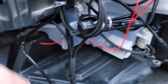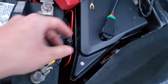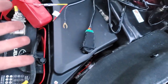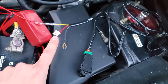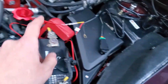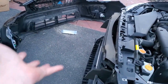With the washer fluid there, there's just not a lot of room. I ran some of the wiring up through here, hooked it up to the battery and the ground. I have my switch here just to test it and see if it works — I don't want to hook all this up and find out it doesn't work. This is probably going to have to get wired inside the car. For now it's out here for testing purposes, and I'll get back to that tomorrow.